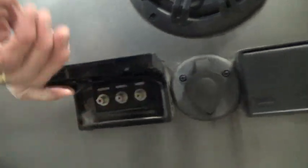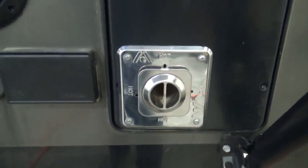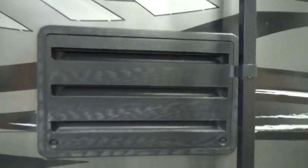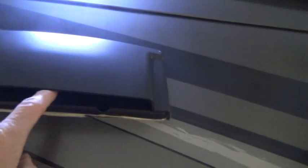There's a bracket here where you can bring a TV out and hook it into your onboard antenna and electric. This is your furnace exhaust — it gets hot, so it's a good idea to have a screen over this opening to keep mud daubers and little varmints out. The back panel is for service techs to access your refrigerator if needed. You have a vent for your cooktop — open it when you're camping and close it when traveling — with a fan above the cooktop to vent out.